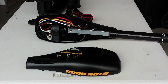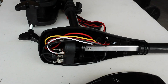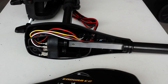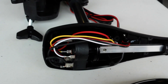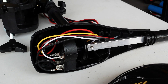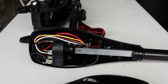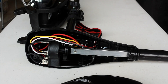This is a view of the top part of the head that's been removed from the trolling motor. Once you do that you can see you have four exposed wires. There's a little bracket in there that holds those wires in place, and once you pull those loose from that bracket it allows you to remove the head from the trolling motor shaft. The next step is to disconnect each one of those wire connectors from the switch. You don't have to worry about which order the wires are connected because they're color coded with each color written on the switch just below each terminal.